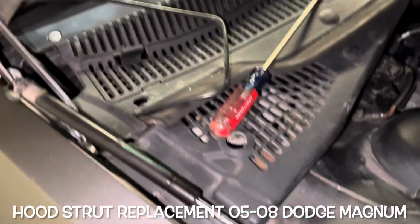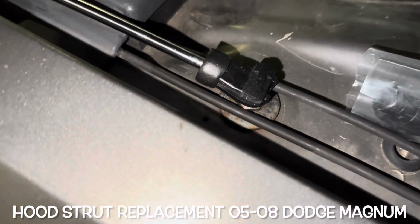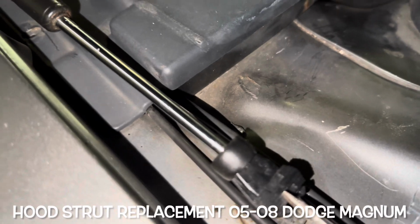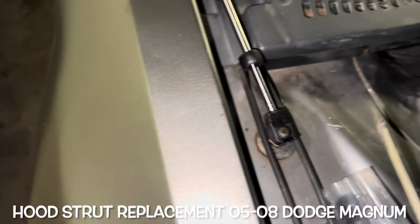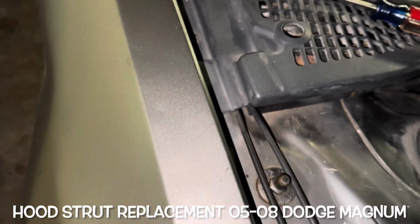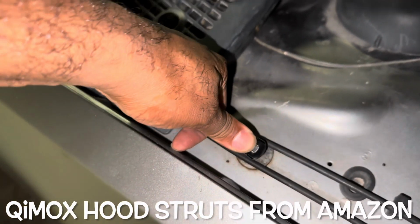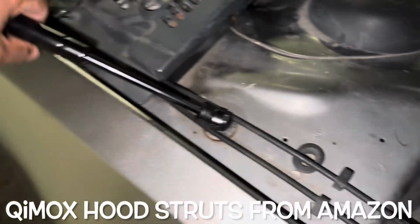You can hit that. Then you come right down here to this one, and this one actually comes from this way, and you see these grooves in there. Push this up, and if you break it like I did, it doesn't matter because you're taking it off anyway. Rotate this way, lift off. That's it, simple. Now all you've got to do is take your angle piece on this particular one here and just push it down. It's snapped in there, it's not pulling out.